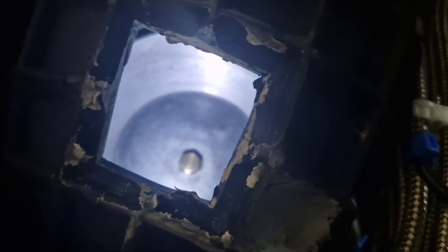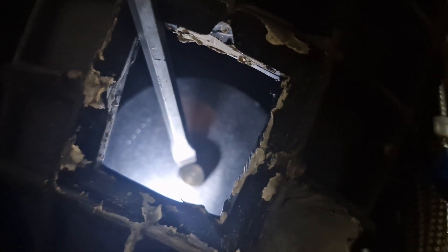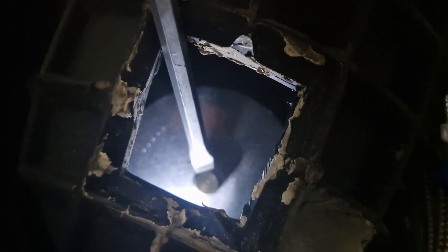We've just popped this out and we're going to mimic how high the plate is relative to the pictures. What I'm going to do is drop a screwdriver and get it flat in there. Right — that there is the plate physically maxed out. The measurement I've got from watching the video and mimicking how this sits: that air plate is about two mil — no more than two mil — from actually physically topping out.